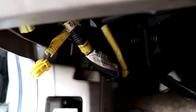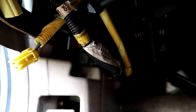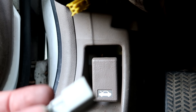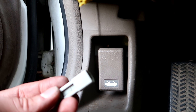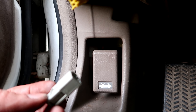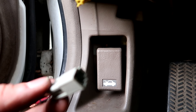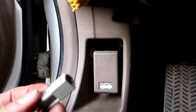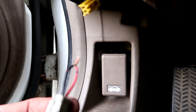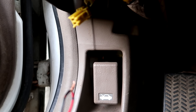Basically what you're going to do is jump the two pins together. I have this plug that I got from the seat on the front seats of a Honda Accord — this is the plug that tells your car if the front belt is buckled or not. I clipped one off and you just loop it here. Some speaker wire or a paper clip will work just fine.